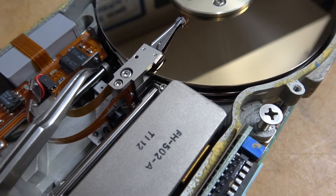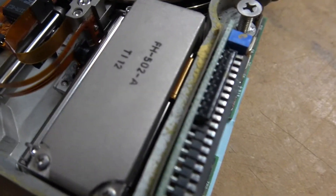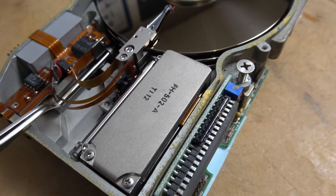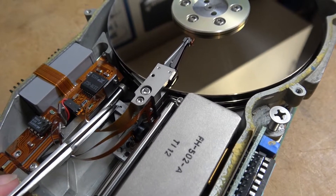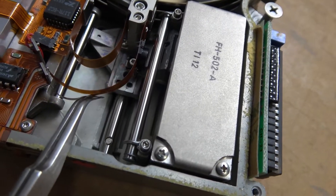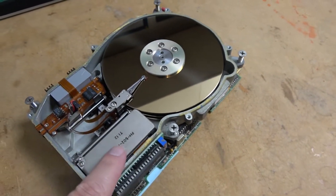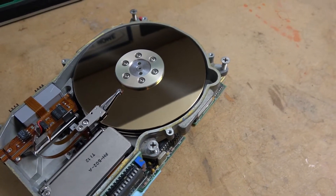The head lock solenoid is down in that region. To activate the solenoid, it comes in off of this ribbon and goes into this pin header which then loops down underneath this piece. This is actually on a spring and that provides pressure to the bearing which is under here. There are a couple more bearings down in this region, and here's the voice coil — this is what moves the head straight up and down. It's different from the modern IDE drives that actually swing from a corner; this one goes straight up and down, a lot like the servo MFM drives from way back when.